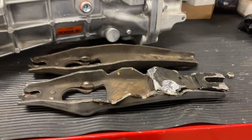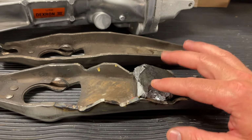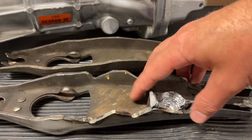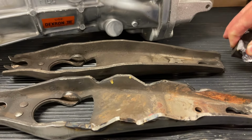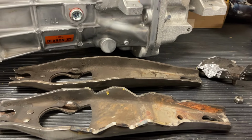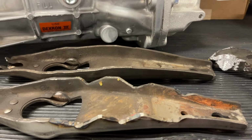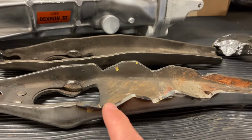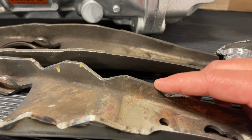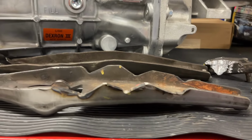Okay, so here's what the notching looked like when it was all said and done. Now, first of all, this dampener, as you can see, we had to even notch it more. So rather than grind it all down, in the end, we just had this removed. Now, you can put this piece on and off of the car with the transmission installed, so that makes it nice to at least do that if you have to. But we had to go down even deeper. So this is what the notching looked like to get across that webbing that's on the front of the transmission on the Magnum on both sides compared to a stock one. So you can see it's quite a significant amount.